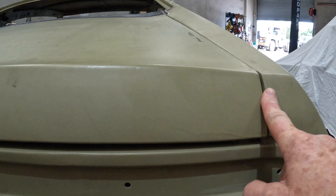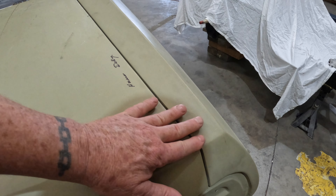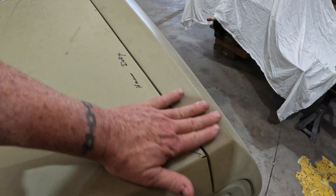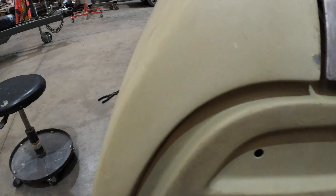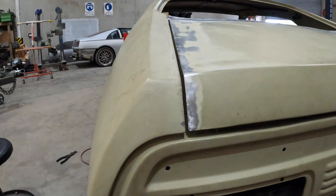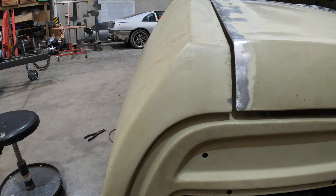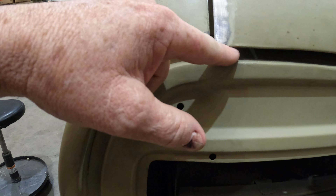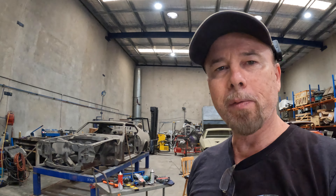On this side I'm just going to use filler to take up the slack because it's probably only 2mm and only goes up to about here. But on this other side something a little bit more drastic is going to be needed — it's probably about 4 or 5mm lower than the edge of the boot lid, and it actually looks like it's dipping down. I think the whole quarter is a bit weird. My main concern is just to get these bottom edges lining up — probably 3 or 4mm difference. Stick around and hopefully we'll make some progress.